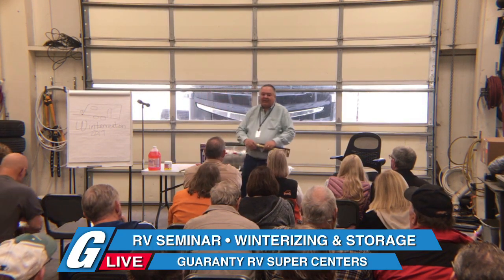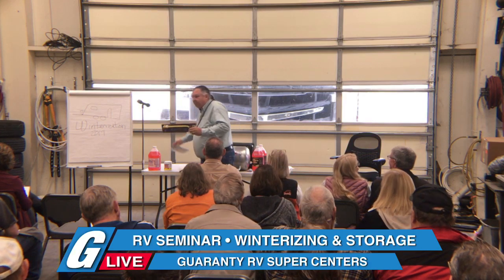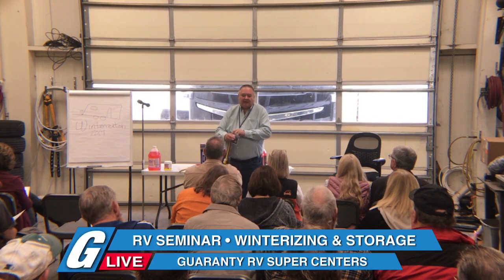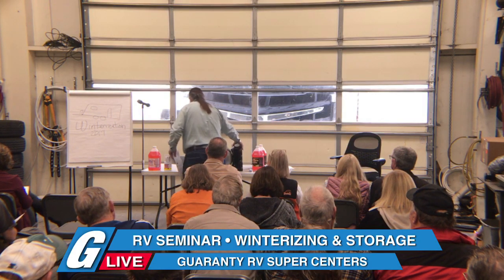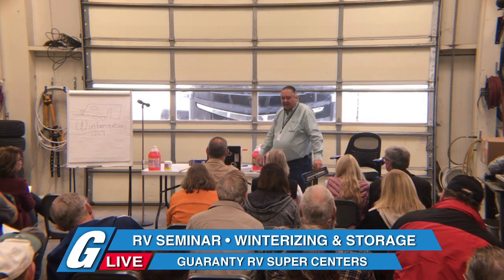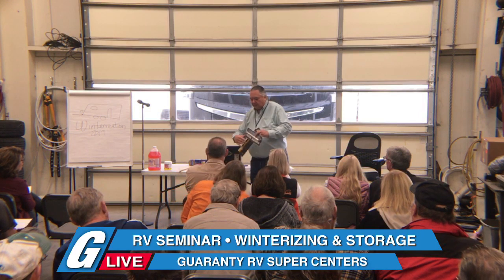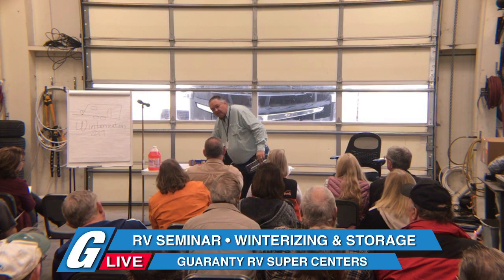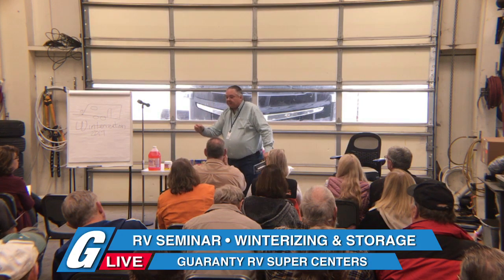If you have been to any of our seminars before, you have seen this little rinse wand. When you take the plug out of your water heater, it's an inch and an eighth or an inch and a sixteenth plug, and it can either be metal or plastic. Right down in there is a little plug. That's the drain plug for your water heater. If it's a Suburban, it will be the steel, which is an inch and an eighth. If it is an Atwood, it'll be plastic right here. This plastic plug, you take it out.